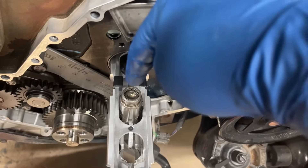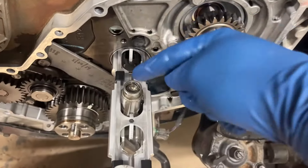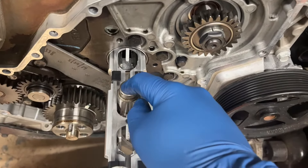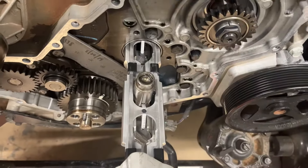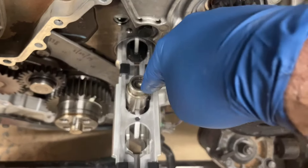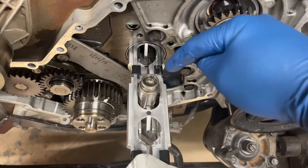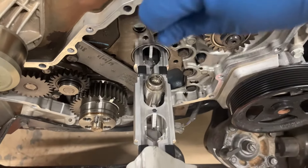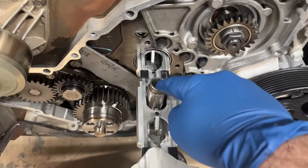If you're using solid lifters or lifters with a spacer, stick your magnet down and make sure it seats into the ball cup. If it hits the side you're going to have a very hard time getting it into the bore. You want the magnet seated in the ball cup — you'll feel it notch down. If you just twist and push it down, you'll feel it jump into the bore.